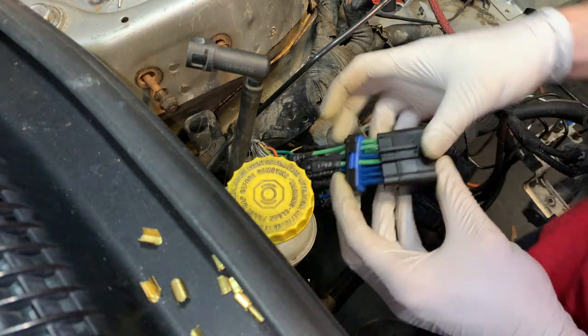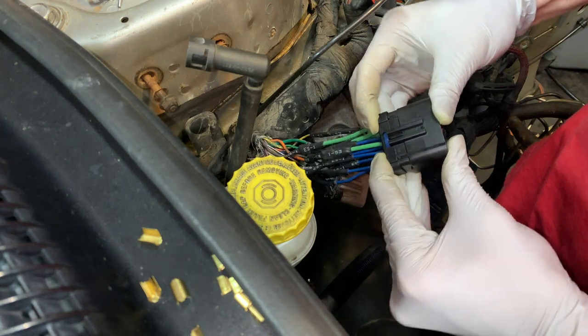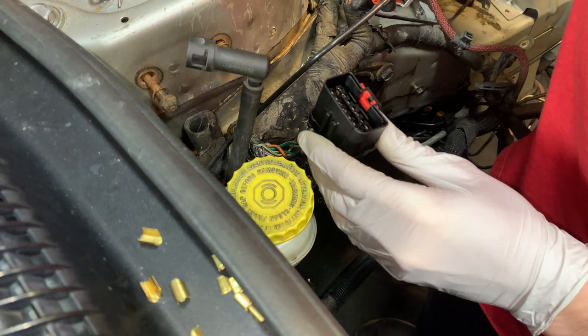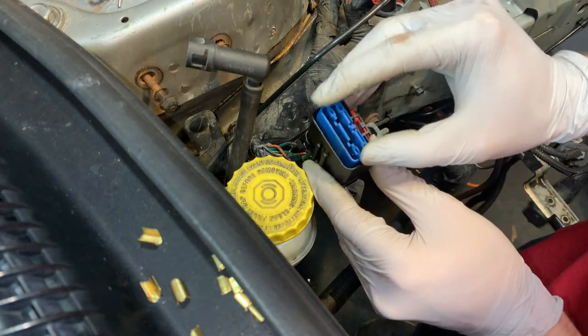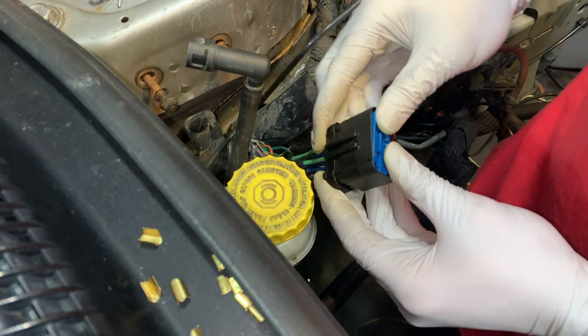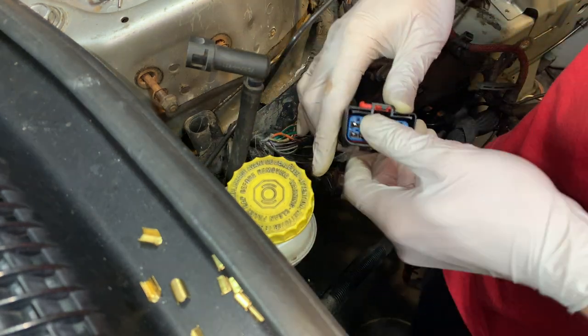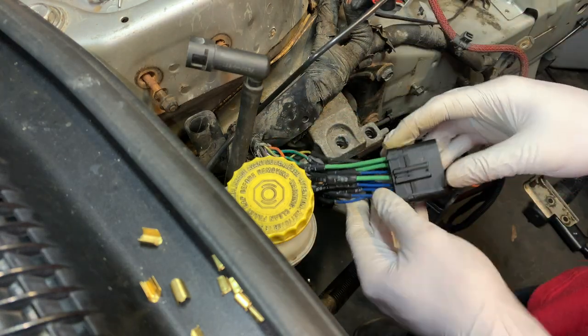So now we got all of the new wires into the new connector, we got the new rubber gasket put in, and the end cap snapped on. Now here you're going to see the blue piece that we saw in the old harness. It's actually from this side. It's the locking part of the actual chassis harness to hold the pins into that.